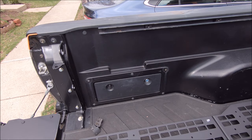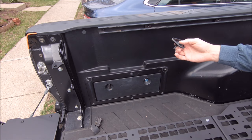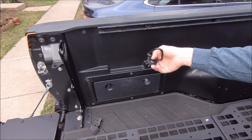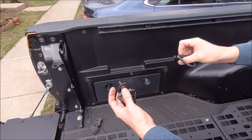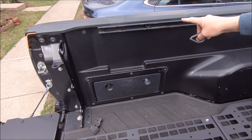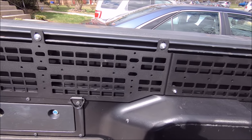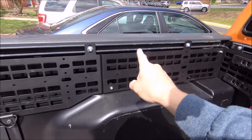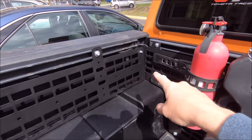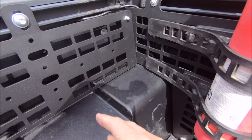And next we are going to actually start getting the rack into place. You are going to reuse those two of the T30 Torx bolts that were on top of your cubby right here. I actually have mine with one of the V-ring or D-rings in them — you can still use those, obviously. Just going to get the rack into position and get these hand-tightened so it'll hold on there, and then attach all the larger bolts with the T-nuts across the top. And here's a quick shot of the installed product — got the three T-nut bolts across the top all installed, the two on the panel right here. And even though I'm still missing the bottom rubber bumper back here, this thing is very solid — you can see if I'm pushing on it, it barely moves.